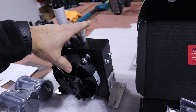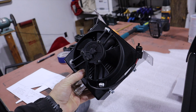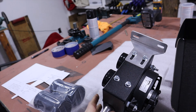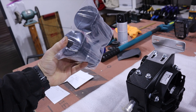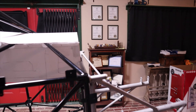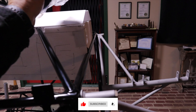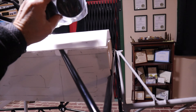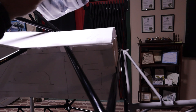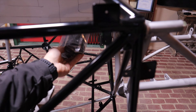This is the heater core I'm going to go with. I am using the Yamaha, so naturally it's water-cooled, so it uses a heater core like you'd see in a vehicle. This is kind of a universal one for a UTV — the Slim Mount from Inferno. It's actually fairly light, about four pounds all in, and it comes with an assortment of bits and stuff. The heater core is actually going to fit in the front section of this cowling — it'll be partitioned off away from the electronics, and the heater core will sit back in that section. Then I'll have a couple of defrost ducts so I can close them off if I'm not using them, plus a couple more down here each pointed at your feet.